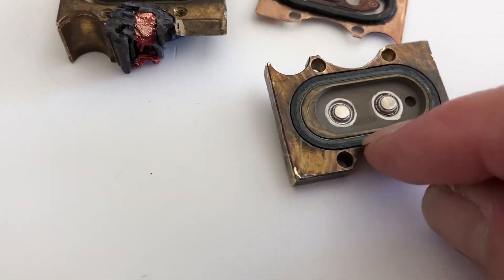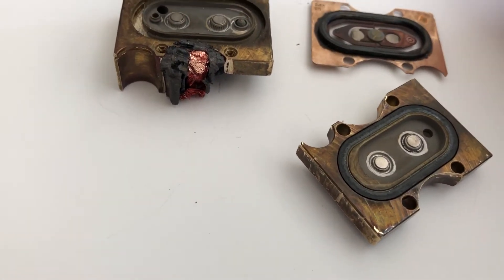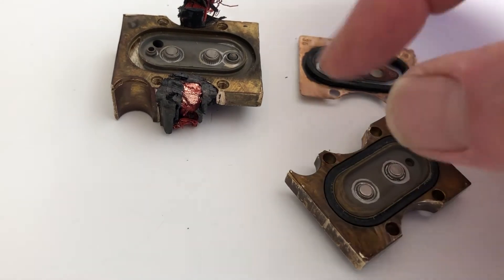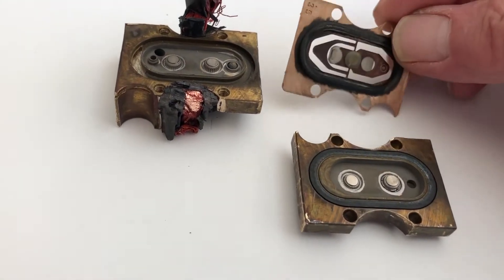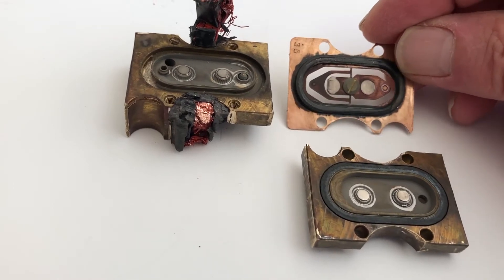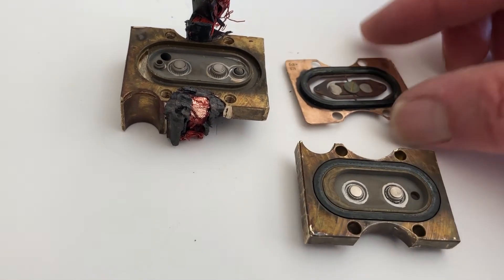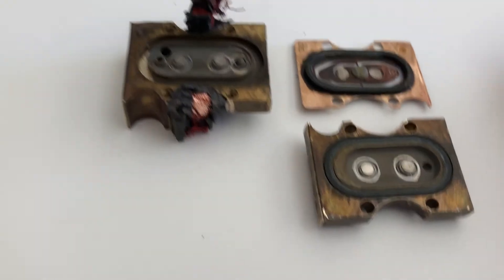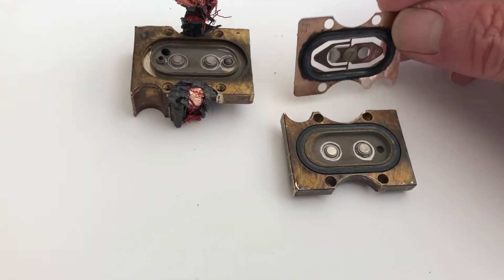When they start to leak, it's either this gasket, or this gasket, or both. There are weep holes on the case of this EHA — I think there's four in the front, a couple in the back, a couple on each side. Being fuel injected, it's under pressure, so it's going to leak. It doesn't leak when the engine's off, but when it's on and under pressure, it might leak a little. When this goes bad, you'll smell gas when you lift the hood, or when it runs and leaks real bad, you'll smell gas inside the passenger compartment.